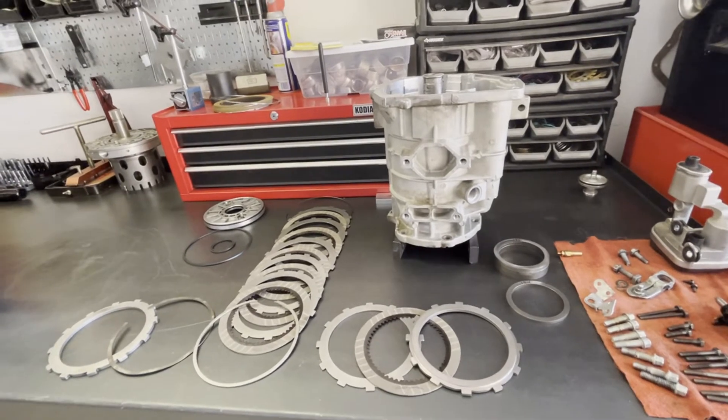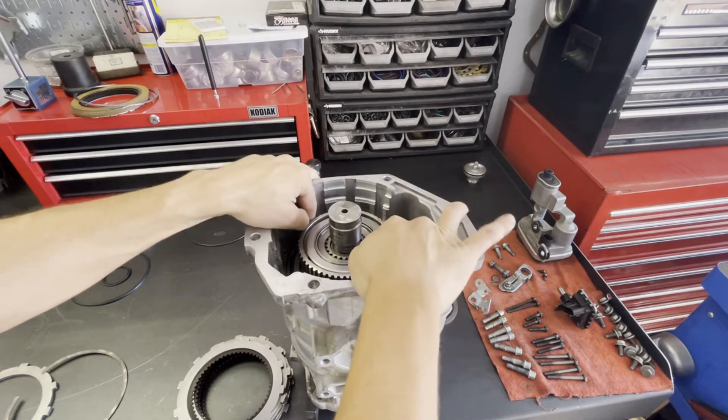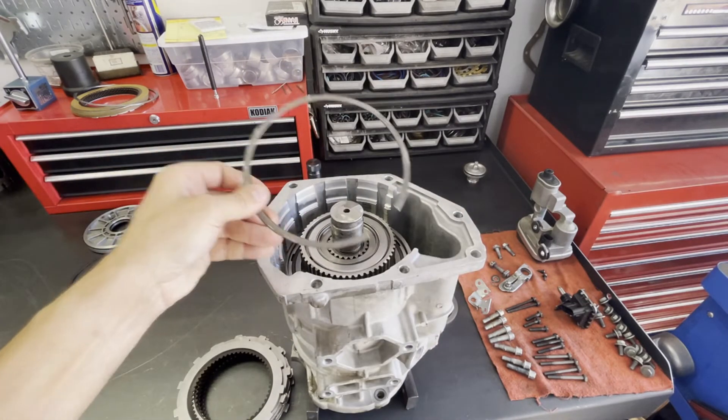Given that we're changing out the pressure plate and adding an additional clutch and steel, we're not putting back the wave snap ring. The 48RE diesels do not take the wave snap ring — they only take the flat snap ring. We're going to need to remeasure our clearance and dial it in using various thickness selective spacers. I'm going to start out with the 184 thousandths spacer, and I have a whole bunch of additional spacers of varying thicknesses if we can't get appropriate clearance using that original spacer.